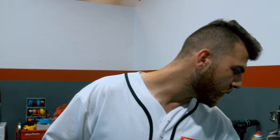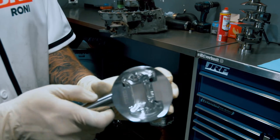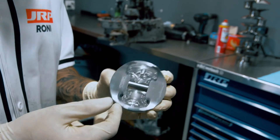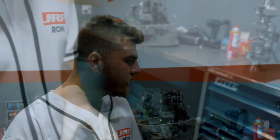These pistons also weigh in at 331 grams, so super light and super strong pistons. Also, the pin bosses are super thick to avoid the pins basically being yanked out in super high, 250-plus horsepower per cylinder applications. So all these are available for customers in our 4G63 lineup, and our 4B11s are coming soon. Thank you.